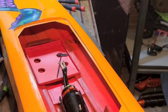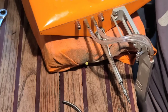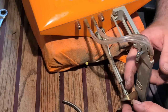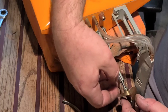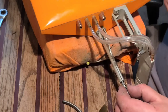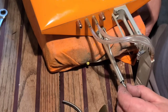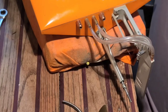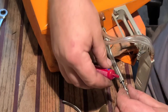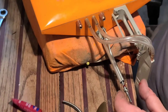You see the drive dog? It's the drive dog, and we're gonna use a big prop so you can see it. It goes on the back side of the propeller itself. Those two dog teeth, I guess you'd call it, line right up with the drive gear here on the back of the prop, and all it has is one grub screw holding it into place on that flat spot in the shaft. I would definitely recommend using permanent thread locker. Lots of vibrations back here on the shaft, and I go kind of crazy with it. But you don't really have to, not with the permanent.